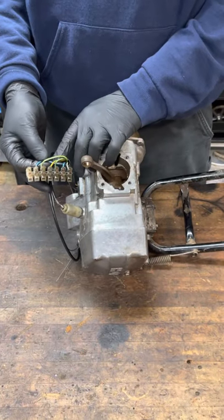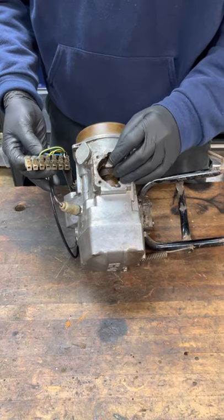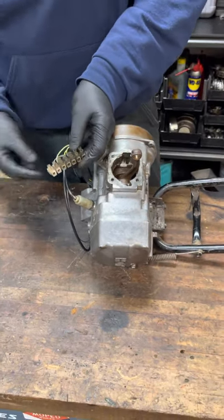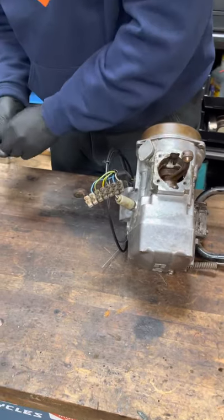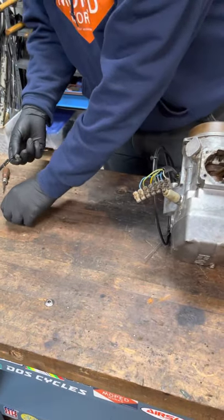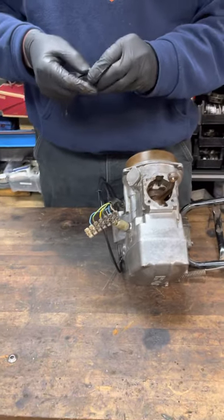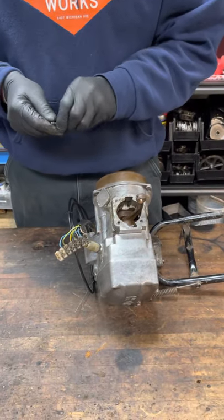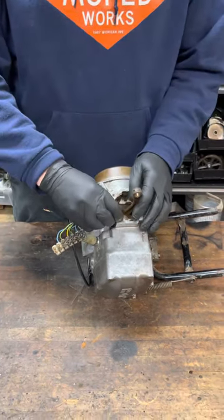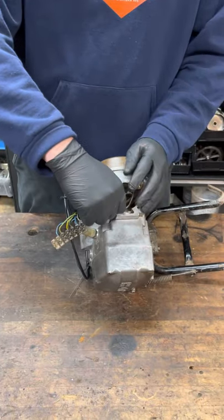A lot of times on the bike I'm going to go ahead and just bypass that so that I know that the problem isn't my horn or whatever preventing me from getting spark. So today I'm going to be — I don't have the stuff in circuit — but what you're going to be trying to do is to ground this black with the blue. I've cut this little wire here and I'm going to ground it to the motor. You can ground it to the frame or any place on the motor. Your goal is just to get a good solid contact with some kind of bare metal which eventually leads its way back to the motor cases. In today's example, we actually just get to use the motor cases because that's all we've got.